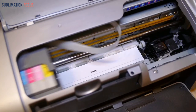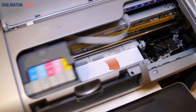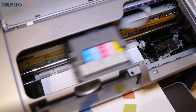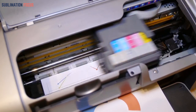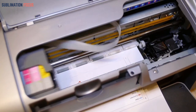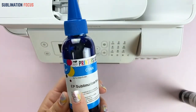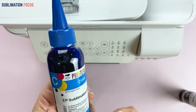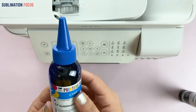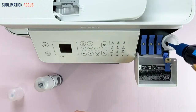Printers with piezo print heads will function for sublimation, whereas machines with thermal print heads will not. In a piezo print head, a narrow coating on the tip is subjected to electrical charges, causing it to oscillate. This oscillation causes the film to stretch and twist, increasing the pressure that pushes ink across the nozzle. The rapid oscillation allows precise regulation of ink flow. Inks based on water, oil, gel, eco-solvent, and solvent are all usable with piezo print heads, found in printers like Epson, Sawgrass, and Roland.